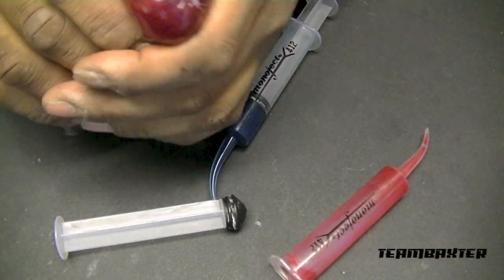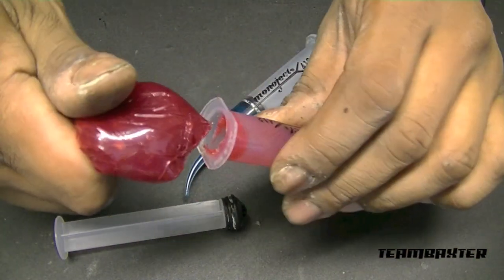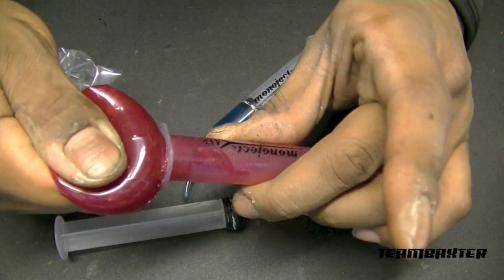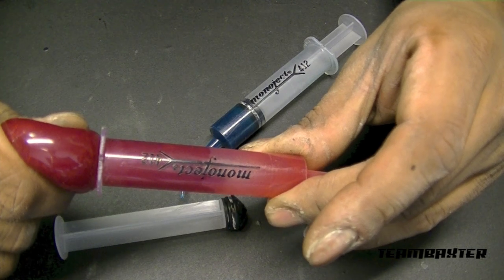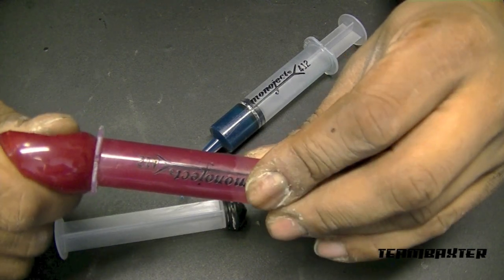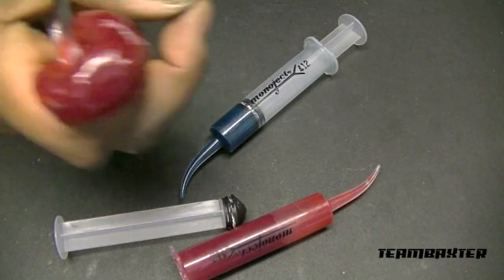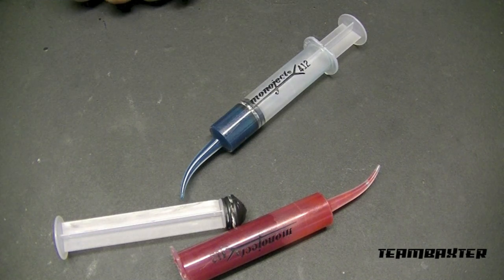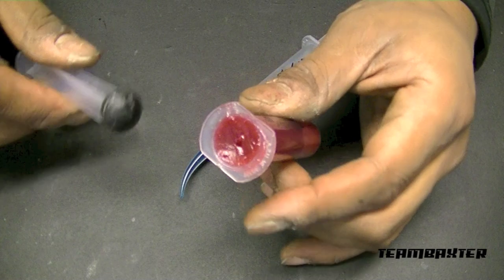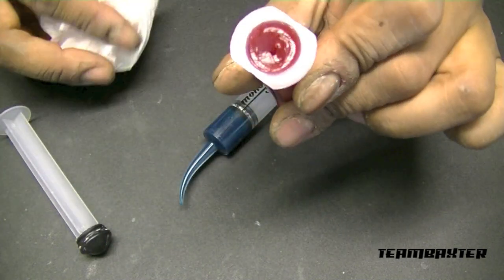Make it just a little bit bigger hole and squeeze the grease down into the syringe. You can see it pushing right on down in there. You don't want to overfill it — about halfway is good enough. It's probably actually a little bit too much right there, so I'm going to pull the bag out. I'll discard the rest or put it back in the tube for zero waste. Throw the plastic bag away. That was the hardest part and you can see it went in pretty clean. Wipe the top off before you put the shaft back in.